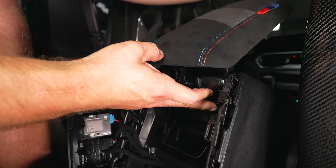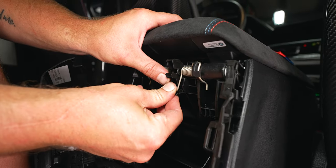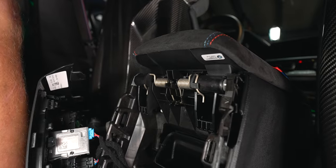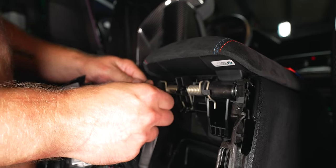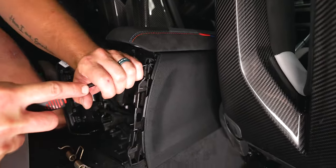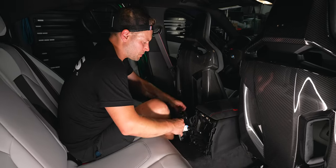It's going to go to the pivot point. Then take your spring — it goes over there like that, then over there like that. It's typically a little difficult to push in, but if you take a flathead screwdriver you can get the clip in first try just like that. Then take your pin and pop that in. Pop this second pin in, and then you can either tap it in with a hammer or push it in if you have a strong enough screwdriver or pick tool.